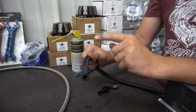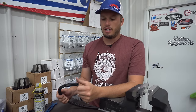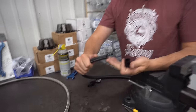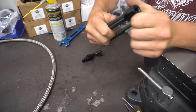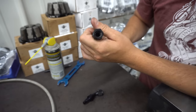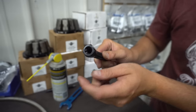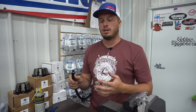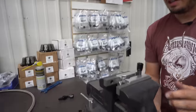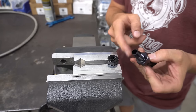Basically what these do is wedge the hose from the inside outward, creating a press fit. Before we assemble this we'll go ahead and cut a clean end on our hose because that's what you should always start with. You can see that there's a steel inner braiding. Fragola by far has the nicest black braided nylon hose — I like nylon braided because it doesn't reverberate sound and heat as much as stainless does, it looks more modern, and it still has abrasion resistance because of the nylon braiding on the outside.